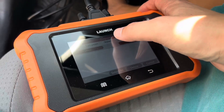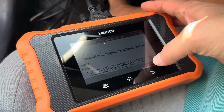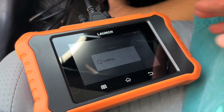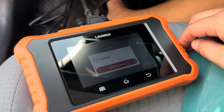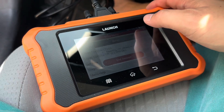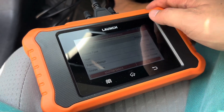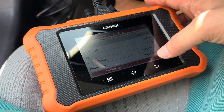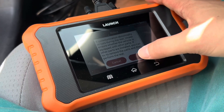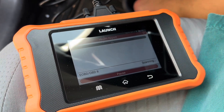Given this is Toyota and Lexus specific, we're going to go straight into Diagnose. We're going to tap on Toyota and through here I'm going to show you how this actually connects. So after loading, I tap the very top option. I'm going to select the year for my car, which is 2017 plus with radar cruise, and we get some information here like the mileage. Now if we continue through, we get some very specific information from the health report.